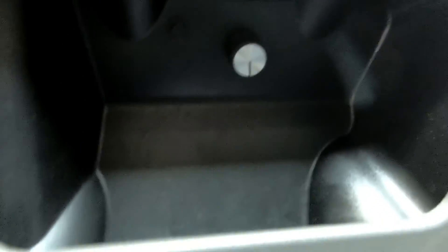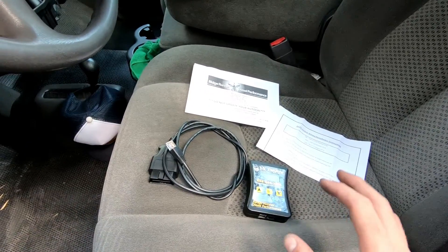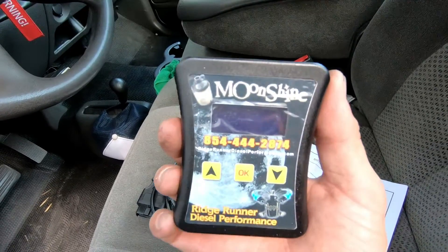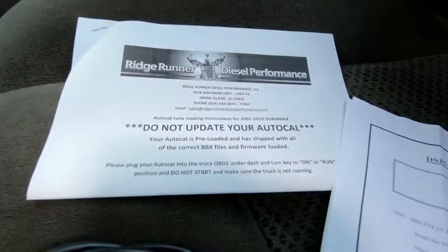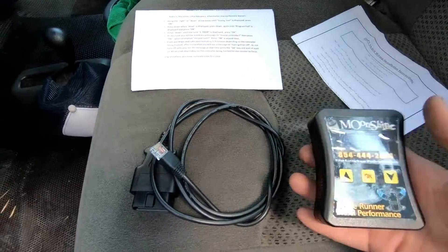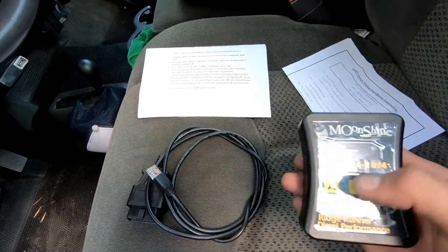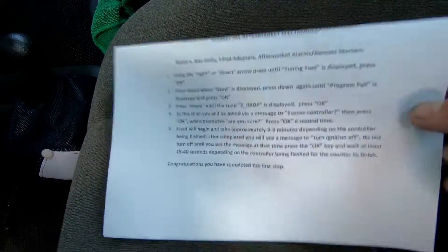That's pretty easy to install. Now you're going to want to install the DSP-5 switch before you download your EFI Live tunes to your truck. Once that's installed, you're ready to install your Moonshine tunes, which is what I run — they are badass tunes. In no way is this a Ridge Runner Diesel Performance sponsored video, I would just highly recommend their tunes. I've been running them for six months pretty hard and my truck has run really well. It comes with instructions on how to install the tunes — you plug it into your OBD-II port, turn the truck to the on position without starting it, go through some buttons, and it installs the tunes. I think it takes about 10 minutes to load them up.